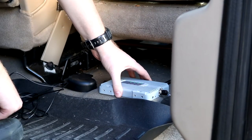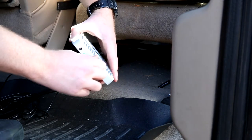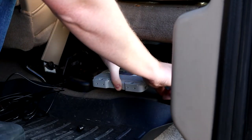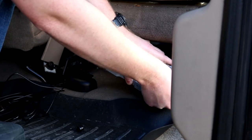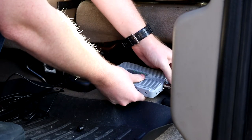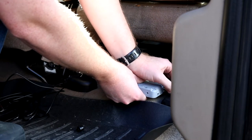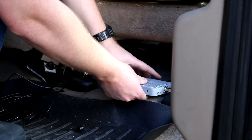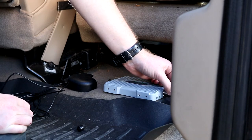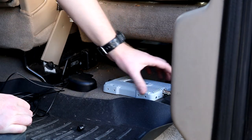So this is where we're going to mount the unit, which is right underneath the passenger seat. I don't have it mounted yet because we'll want to do a full test before we get it mounted. So this is the outside antenna port. I'm going to take my antenna from the outside there and I'm going to place it in and screw it into place. That's finger tight, and when I actually mount it, I'll probably take a small wrench and very lightly tighten it just a little bit more than finger tight, just to keep it locked into place.